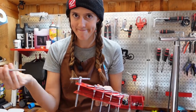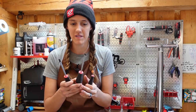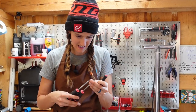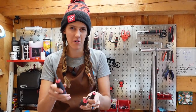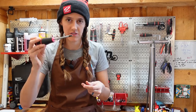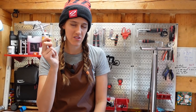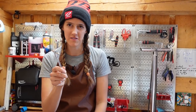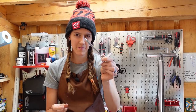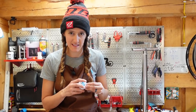You pretty much use Allen keys for every single thing you do on your bicycle. You also want to have a set of screwdrivers. You probably already have at least one Phillips head and flathead somewhere in your house. Most of our bikes don't actually have any screwdriver fasteners, but we still end up using them for lots of stuff. On older bikes, you will need a screwdriver to adjust the derailleur. You'll also want a T25 tool — if you have SRAM components or six-bolt rotors, this will be very necessary.